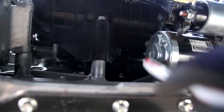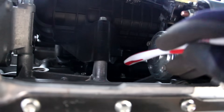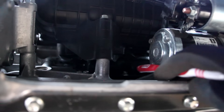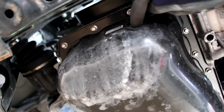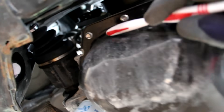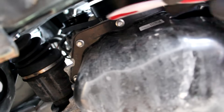Looking up underneath the intake next to the starter here is the PCV system — an oil separator that's going to separate any oil from the crankcase side of the engine, let that drop back down to the oil pan, and then the remaining vapors can go back into the intake system to be burned. The reason this oil pan is so deep is because the timing chain actually runs inside of here to power the oil pump and the balance shaft. Further up inside of here there's an oil control valve that controls that oil pump electronically.